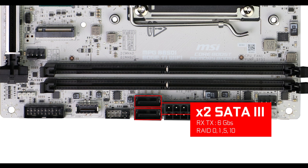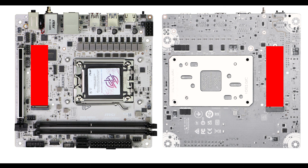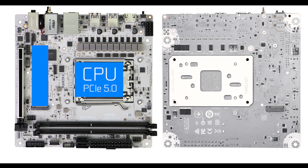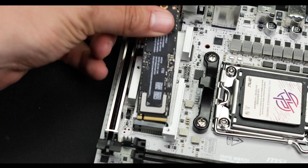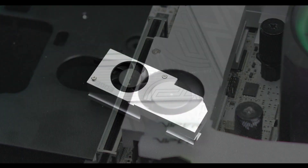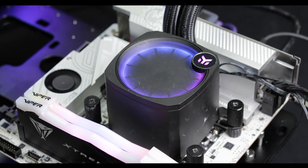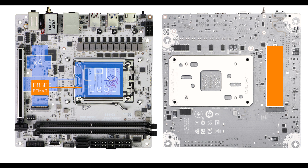In short, with the right kind of memory sticks, this board is on memory steroids. Storage-wise, the board comes with two legacy SATA 3 plugs for cheap, slow but massive storage, and most importantly two M.2 NVMe connectors on each side of the PCB. The front one is the only PCIe 5.0 enabled one, meaning transfer speeds up to 128 gigabits per second, and it gets the hottest — hence the massive thermopadded heat block with silent active cooling. The rear M.2 is chipset-fed and still swaps data at a plenty fast 64 gigabits per second. Overall, all the promises a B850 board makes are largely kept here.